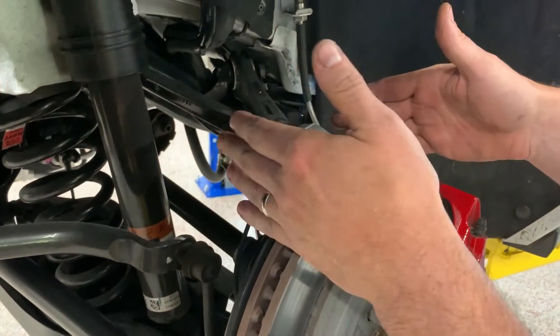Here are all the control arms on the workbench. We'll start at the back — I was just talking about the toe link. This is the factory toe link here. It's this big, huge dog bone looking piece. It's not a bad piece — it actually has spherical bearings already in it, so you can see them kind of moving around. One of mine is clicking inside, so that was another reason I wanted to replace it. You can feel it clicking and I didn't really like that. Structurally they're fine — the sphericals are fine — except it will make a little bit of noise. But the main purpose of eliminating this was to get rid of the eccentric adjuster.